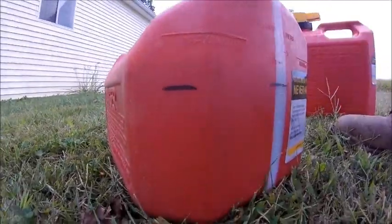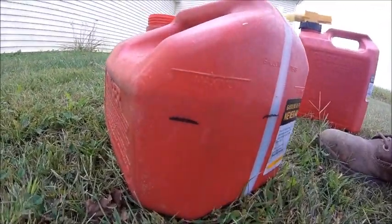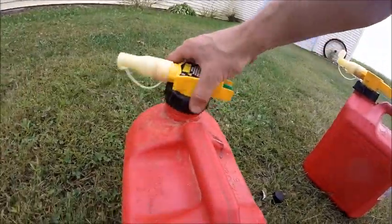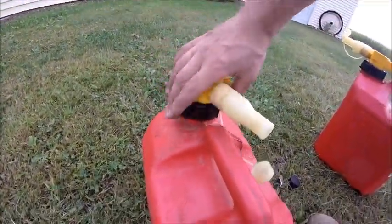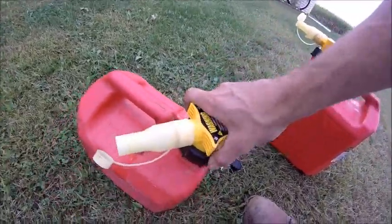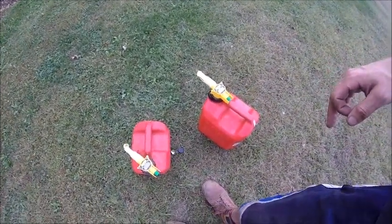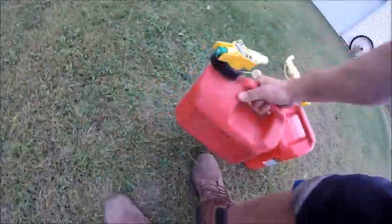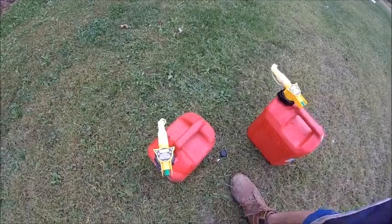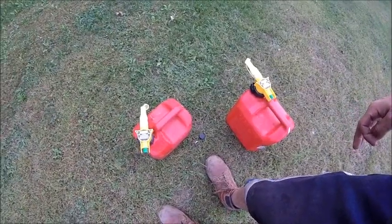As you can see, I've filled it to the line right there — maybe a little above, but it's okay since there was already a little in the bottom at the beginning. Now I put this cap on, and before use you're going to want to shake it, because it doesn't mix well together on its own — it needs an extra shake similar to this. So hopefully now you have a better idea of how to mix gas and oil to make two-stroke gasoline.